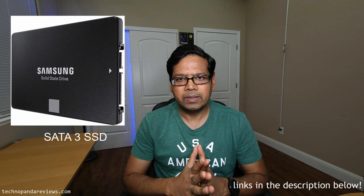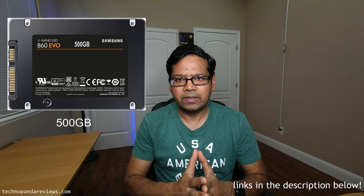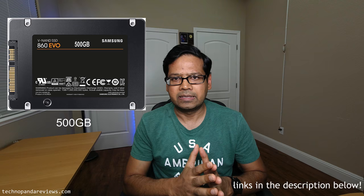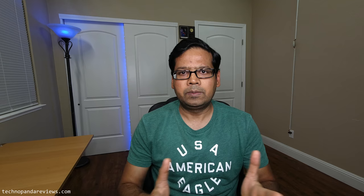So I will not recommend that you get the M.2 SSD. Some people do claim that NVMe PCIe type SSDs are faster, so if you really want a fast SSD then maybe that's the way to go. But for most people, the easier option is to leave the M.2 drive in its place, don't mess with it, and go buy a SATA 3 SSD. I'll throw a link in the description of all compatible SSDs. For example, you get a 500 gigabyte SATA drive that becomes your secondary drive and your existing 128 gigabyte drive remains intact — so you now get 628 gigabytes of storage total.